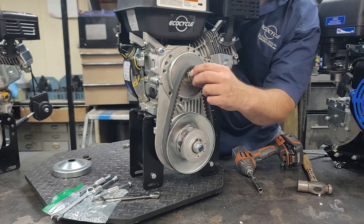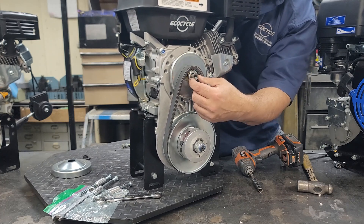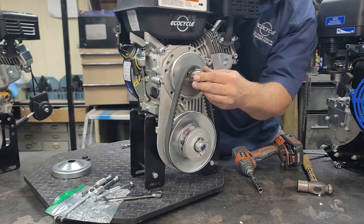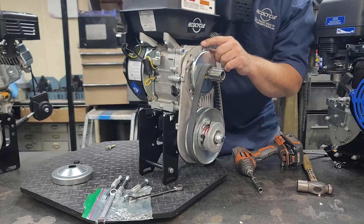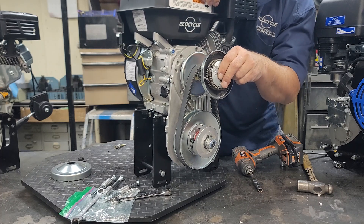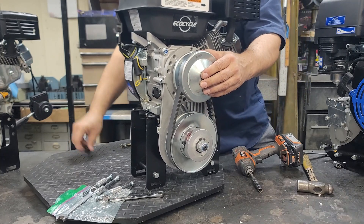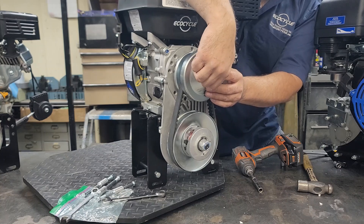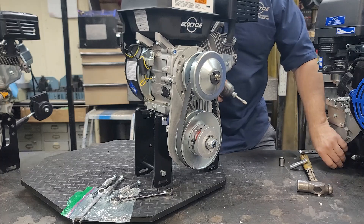Now the drive hub. One thing I really dislike about CVT kits — which the power pack does address — is engagement. There's maybe half an inch of shaft sticking out, and that half inch has to catch the driver hub. The power pack engine drive with the gearbox eliminates this backing plate so the clutch sheave can sit much closer to the engine, giving you way more engagement on that spline driver. Finally, we put in the clutch bolt — up to a two-and-a-half inch bolt works with these CVTs — and tighten it all down.